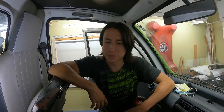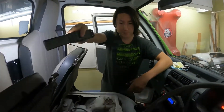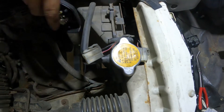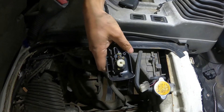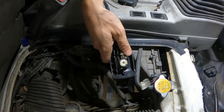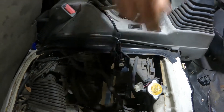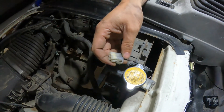I rang out as many of the wires as I could, but it got a little awkward trying to go behind the cab and into the cab by myself, so I had to wait for Sue to come home to give me a hand. These are the two plugs in question — the ones that go into the front solenoids. When you push the shift switch for four-wheel drive, you do have power on one side and it makes properly, but it doesn't seem to send any power to the front solenoids — only to the rearward ones. The black wire ohms to ground as expected, and the red and blue wire one would think would be switched power controlled by the switch, which as we discovered it is not.